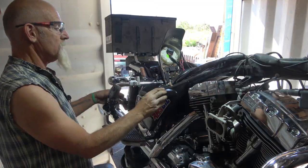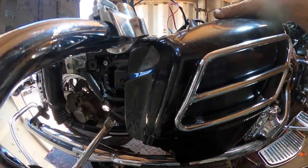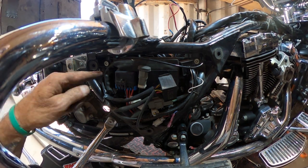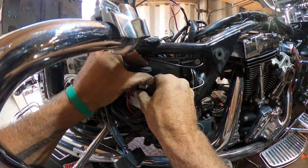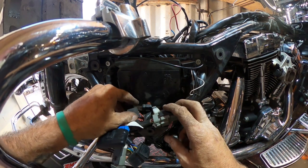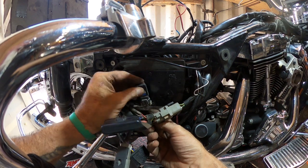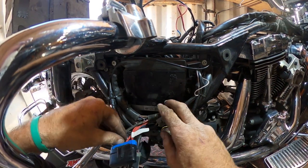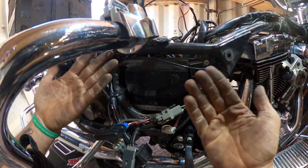Right behind this cover right here is the brains of the operation — or not so smart right now. I've got to get my blinker kit out of the way, get that disconnected and up out of the way. Then there's the barometric pressure sensor right there — that ain't going to be needed. I've got to get my 7/16ths and pop that out of there.